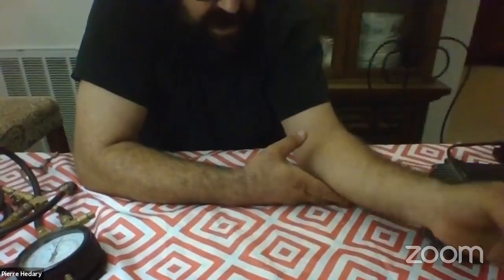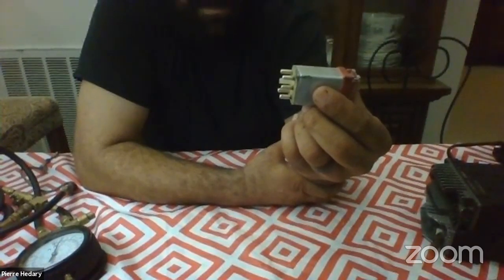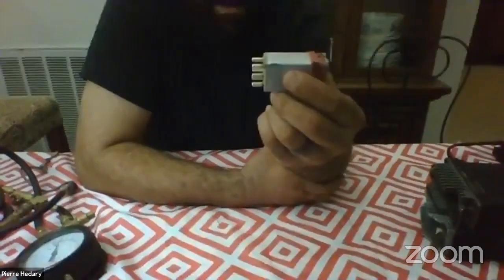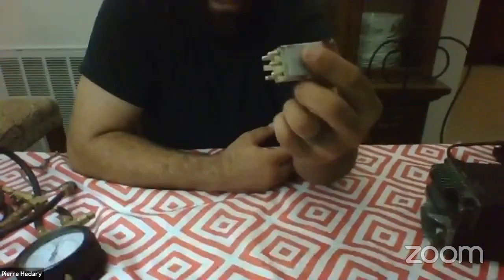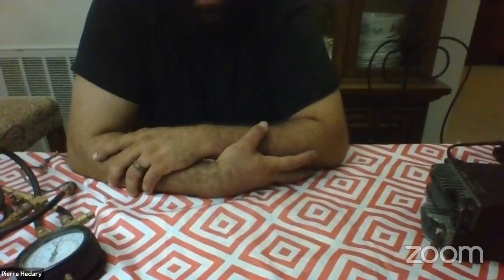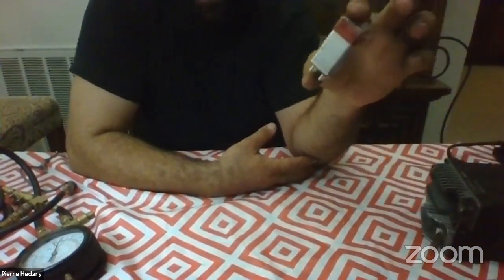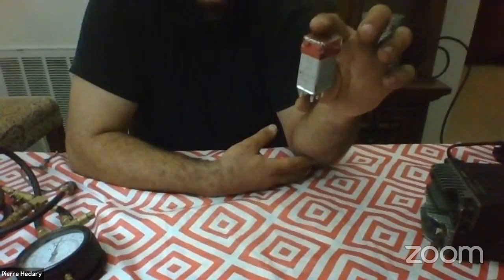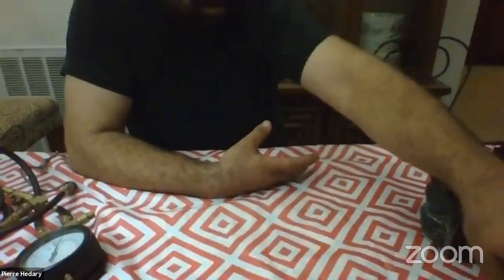On the 107 chassis, the OVP is on the side of the inner fender above the fuse box. You'll need to pull the lower dash panel — it'll be pointing toward the center of the car right above the fuse grid. On a G-Wagen, drop the lower dash panel on the right side and the OVP will be in the wiring harness connection area below the right side of the dash.